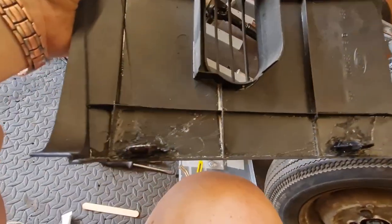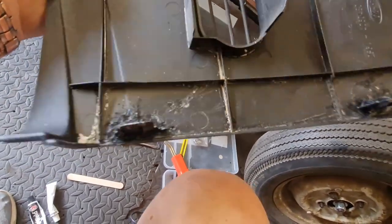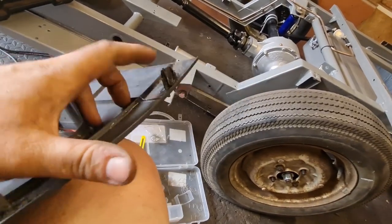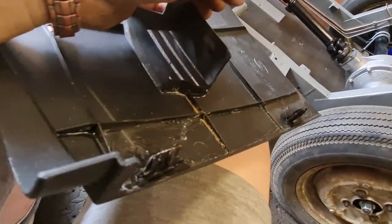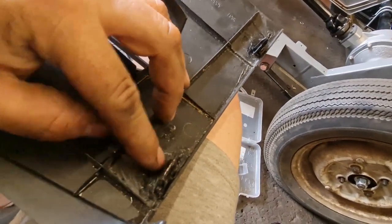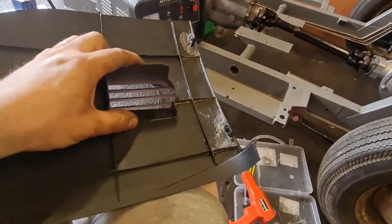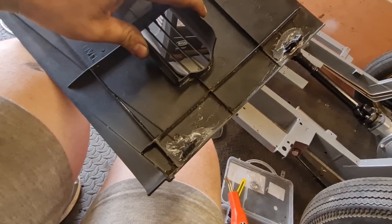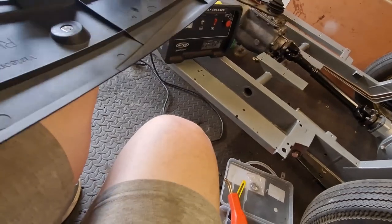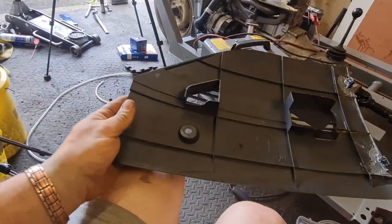I'll just show you what I've done on here - as you can see, they're both reattached. I've put three staples in each one and then gone over them all with a soldering iron to smooth it all in. They are nice and strong. But what I'm going to do just for a bit of double added protection is put a bit of JB weld around the bottom of them as well, just to give them a bit of extra strength. That can go off while it's in the car. Not particularly pretty, but hopefully it'll be nice and strong once that sets, and plus the staples and the hot welding with the soldering iron as well, that should be lovely and strong. So I'm going to get that clip back inside the car - it just pushes in on these two clips and then you've got that one the other end. Job done, lovely jubbly.